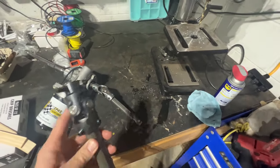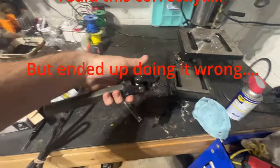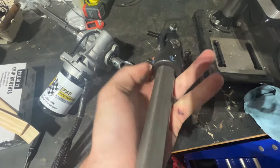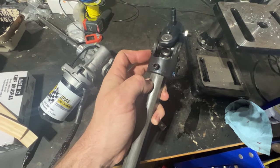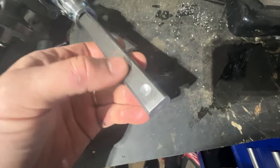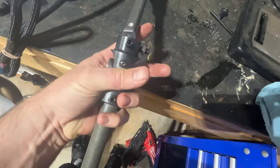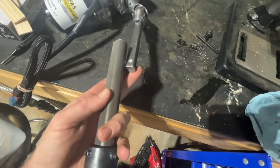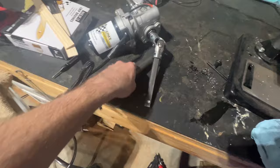What I actually didn't realize is that there was a second coupler. This is the one that's going to attach to my steering box. One of these screws is really long and it doesn't seem like it's supposed to be like that. So what I did is I drilled through this piece of metal and a little bit on the inside of this wall so I could seat that in there real tight. For this other one, I just created a little dimple. I'm just realizing I'm an idiot — I made a dimple there for this when actually this goes on this side. I'm really glad I didn't drill all the way through. That's where a manual might've been good. So this is going to slide right in there and screw into the steering box.